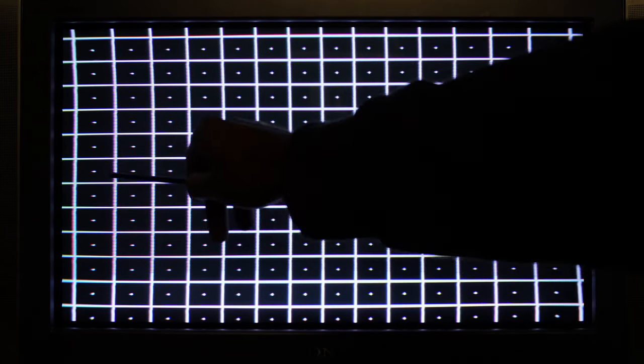A bit of misconvergence — two in the columns, a bit of red tinge on the edge. This is a lower-end set, and that's probably a good point to getting to the conclusion. There's our colours, looking very vibrant. This would have been, or is, a low-end model, and that's not necessarily a bad thing at all. I'm all for the cheapo televisions, because they often produce the best results.